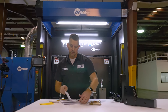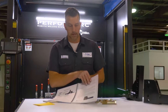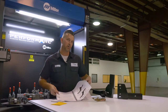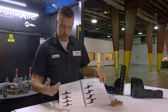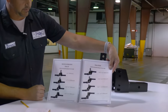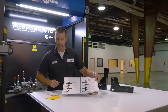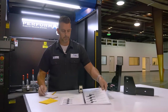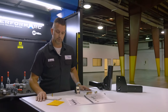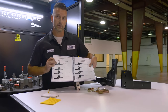If you look at the manual, you can go through all the steps on pages 7 and 8. Once you get the math figured out, you can actually just go to the pictures because we've done that homework for you. Once you figure out your difference — which in our case is less than an inch, a 0 to 1-inch difference — that's our picture right here. I already figured in my 5-inch settle, so we're going to set this hitch bar up according to that picture.